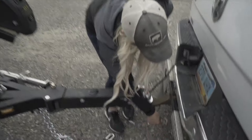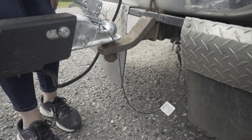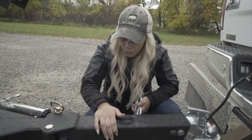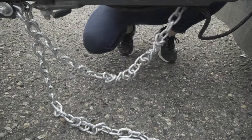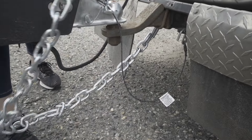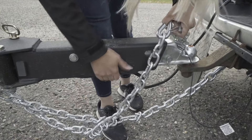Take this safety cable for the brakes and attach it — I attach it backwards like this, I feel like it's not going to fall out as easily that way. Then take the safety chains. These are really important so doing these correctly is a must. What Matt and I like to do is crisscross them so they can catch in case of an emergency, but we don't want them to drag. So we're just going to turn these a few times to make sure they're not dragging and getting scratched up on the tar, then attach them. The important part is to make sure they're spun around enough that they don't drag, but crisscrossed to catch the tongue if it ever fell.